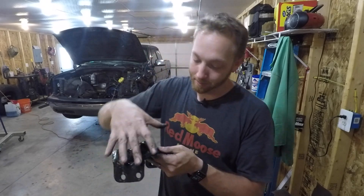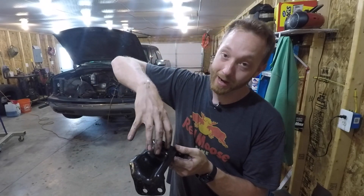I've got the frame mount taken off and I've already run into a couple of roadblocks. I'll get to that in just a second because it's not a huge deal — all the solutions already exist in the parts I have between these two engines. The frame mount bolts onto the frame and the motor mount bolts to it, attaching to the engine and holding everything together.